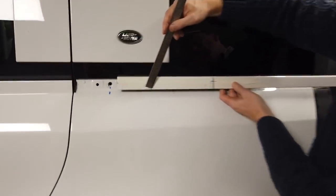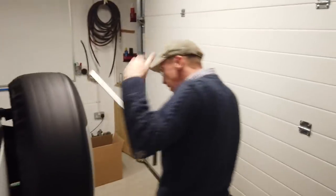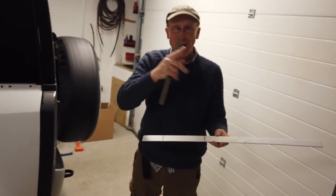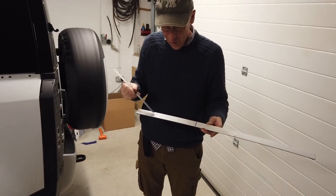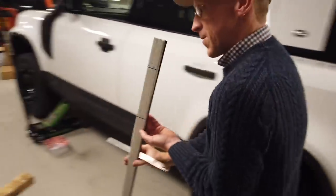Land Rover don't give you any dimension in the vertical direction here, so it seems to imply you drill in the centre, which is what we did on the other side. But when we drilled in the centre originally, you can see the hole is much higher than the centre - almost right next to the top. So we are going to drill it at approximately 23mm towards the top. Don't go drilling at 23 until you've watched how this turns out - it may well change. This is our first time doing it.